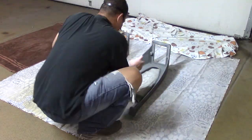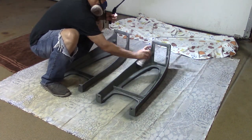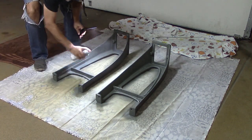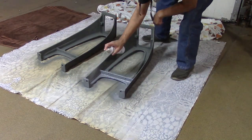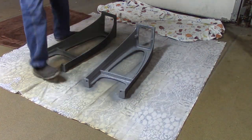Now on all the pieces, what I use is an etch primer, and I just dusted it with that, then I go back and do a heavier coat with the etching primer. Then I use a high build primer, and then I put the paint on, and it's always nice to see that paint go on — it really transforms it.